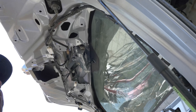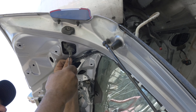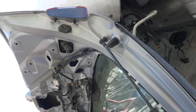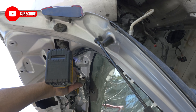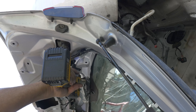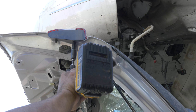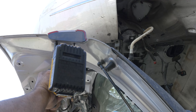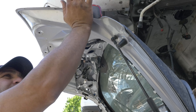That needs to come out. I'm gonna unplug this thing first — this is easier while the headlight is still loose. There are two bolts right here, one right there. Once you get those out, give it a little nudge.